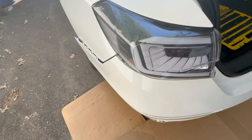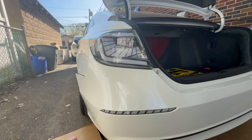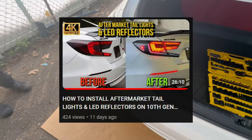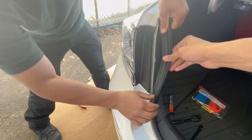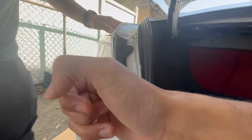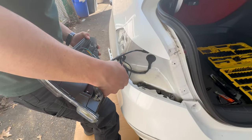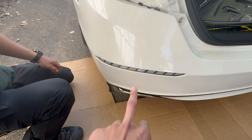Alright guys, we tried to take the bumper off just leaving the light on, but it's gonna be a little difficult and I don't want to scratch the light. Also, when you're putting the new bumper on it's just gonna be harder. So honestly it's better to take the backlight out — we're gonna show you guys how to do that, just like we did in the last video. You're just gonna take the rubber piece off right here, then take this part off. All you gotta do is take the two bolts off and then you can take the light straight out.